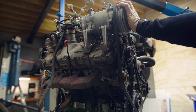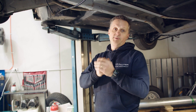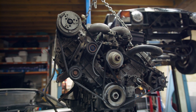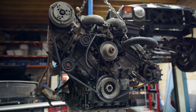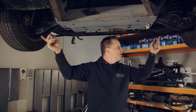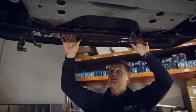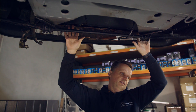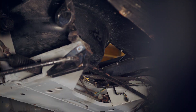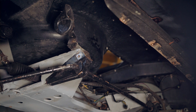Another aspect of removing the old combustion engine was that it had to be cooled, so there was a radiator at the front. Originally the engine had cooling pipes running through the whole system — all the way through, all the way around, all the way up to the front. Interestingly, the radiator was actually bolted to the air conditioning condenser, so we've got to refabricate the air conditioning system as well now, to make that live where it was previously.